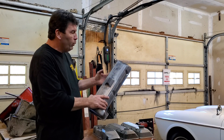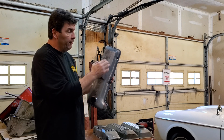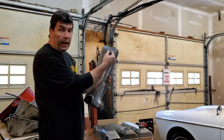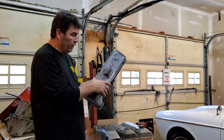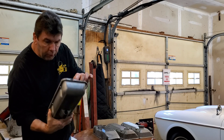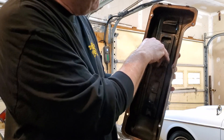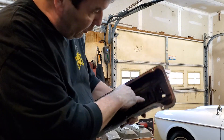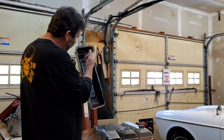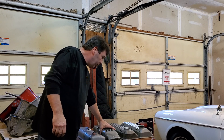On a 75 there is one difference — there's a piece welded on the valve cover because you've got fuel injection in 75, and there's a piece on the fuel-injected models for the cable to go into. But there's nothing functionally different beyond that. Inside you have your vent material — there's a little bit of material there to capture all the oil and make sure it drops down in. They're like a vent tab and they're not easy to replace.